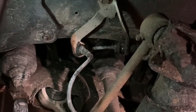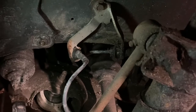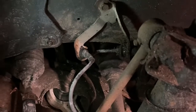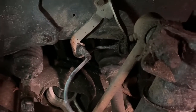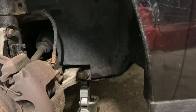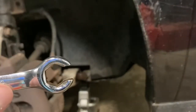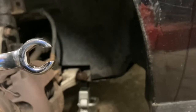The first thing I'm going to do - it's hard to see because it's dark - but right there you can see where the brake line connects to the brake hose. It's probably corroded. I'm going to tackle that first and make sure it comes loose, that way the rest will be easy. I'll heat it up, blast it with WD-40, and try to get it off. For this project, always use a fitting wrench - it's got a six-point bolt head with a slot for the line.